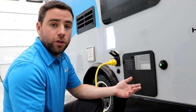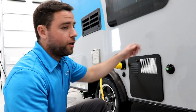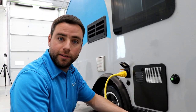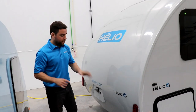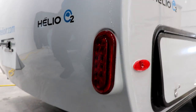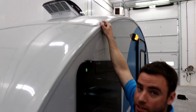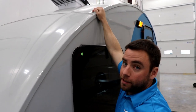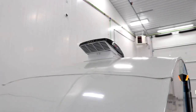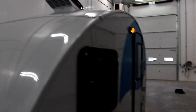You can actually move it by hand if you want — some people aren't great at backing up with a car or truck with a trailer. You can do it by hand because the tongue weight is only 110 pounds, so pretty light. The LED lights are fully molded too, so no maintenance to do — there's no danger of water getting behind or inside the light. We've got a seam here because we have two panels for the roof, but it's all fixed with epoxy so there's no danger of water getting in from there. And the Max fan installation sits one inch higher than the roof of the trailer, so you're sure that no water is going to come through the Max fan.